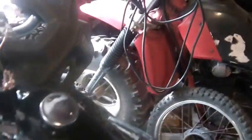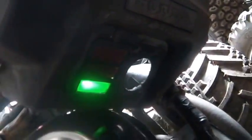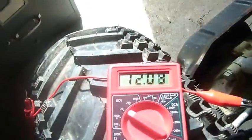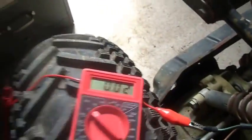It engages those two, which would tell your starter to start working. So, given that I've wired it up as we've just described, take note when I turn the key to an on position, what happens? Whoa, lights come on. Gotta like that. And check out what happens here. This is one of the lights that would be in the grill, and you see the 12 volts there. And then if I turn it off, right, the 12 volts goes away. So I'm feeling really pretty good about this.